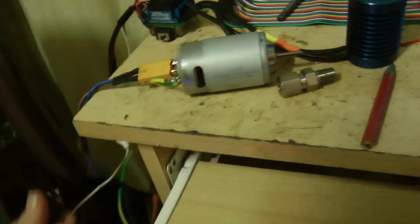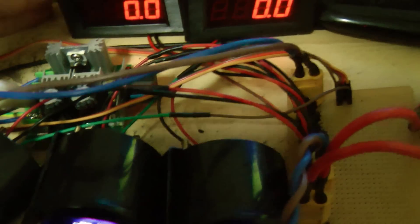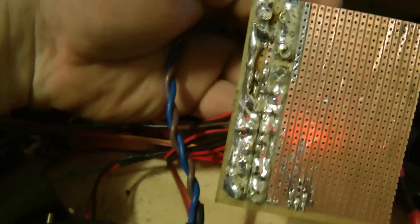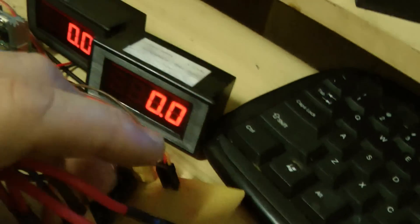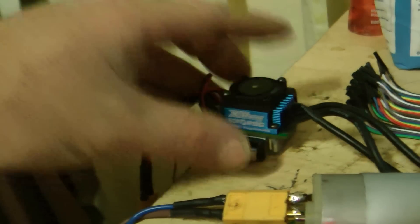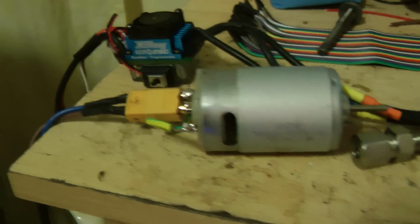I'll give you a look at how it all operates. I'm going to have a switch down here. I've got the wiring loom — that all goes on the actual jet itself and this all goes up into a console. I've connected all of this into a board just here, all the plugs, which are relatively cheap on eBay. It all plugs into the one board. When I was testing, I think I've burnt a few of the rails off and forgot to reinforce the solder on the rails. This is actually programmable — I've got a card to program it as well.